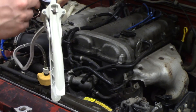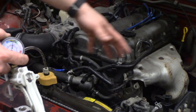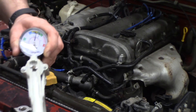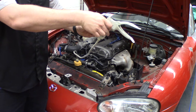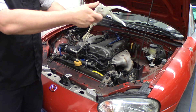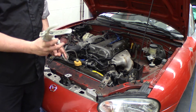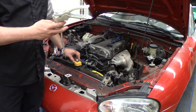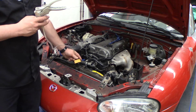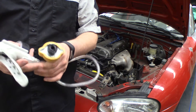If the pressure drops a whole lot, that tells us there's a problem — it could be a head gasket leak or an external leak around the engine. In that case, take a flashlight and go around looking for where the leak is. To release pressure, push on the vacuum release a little bit at a time. Sometimes coolant comes up the hose — if it does, stop pushing the vacuum release or coolant will get inside the pump and could damage it. Once pressure is released, take off the cap and rinse it and the hose off over a sink.